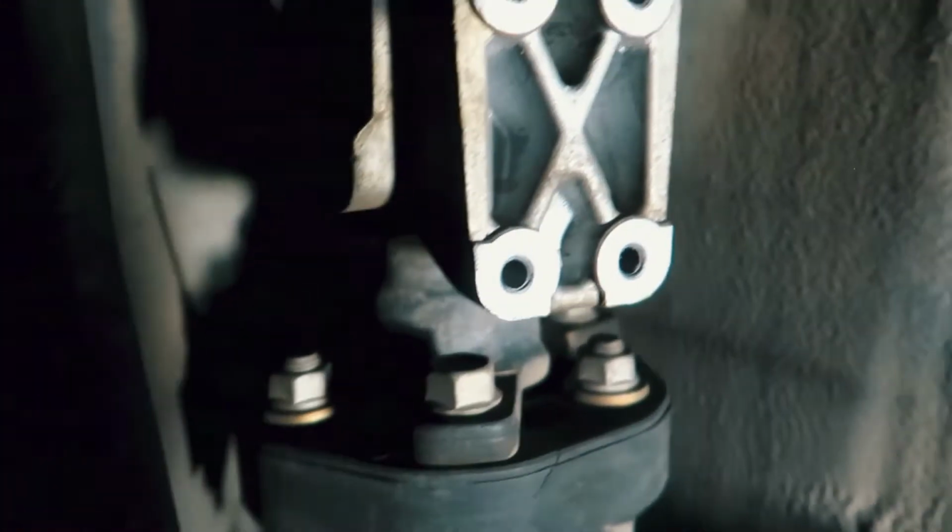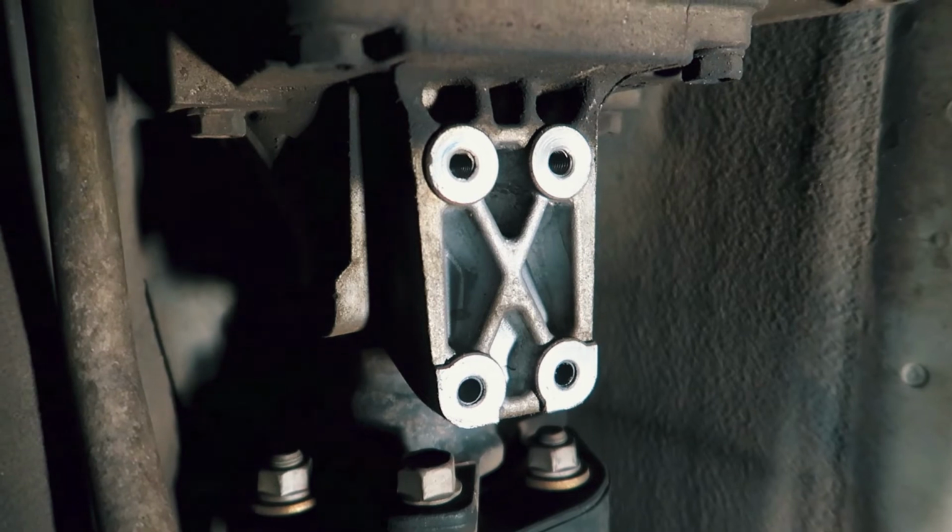Oh man, oh well, the transmission mount is now out. All right, so now that I'm under the car, I was genuinely confused. As you guys saw, that top plate fell on my face, and then while I was under the car, I picked it up and I was like, how is this the new one? Watch, let me give you guys a better example. So this plate fell on my face, as you guys can see. I was like, if this is the old mount, that makes no sense. So looking at the new mount, as you guys can see, those are 2 completely different things. I was trying to figure out, did I order the wrong part? What's going on? This looks nothing the same. But as you guys saw earlier, I forgot to undo those 4 12mm bolts to separate it from the crossbar. This is the rest of the mount. The mount is completely in half.